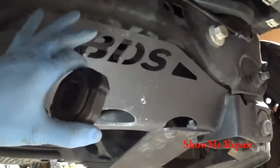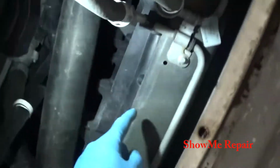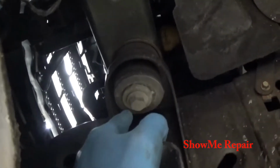And obviously I have a 6-inch lift on this thing. If you had a stock truck, you wouldn't have that opportunity anyway, because then that would hang down closer to the road, and you wouldn't want to do that. But what I did figure out is this radiator support here. Put this light up. If you look up here, this support is kind of the main support of the body that hooks the left and right fender. I think that piece even goes up. Yeah, it's where the body mounts to. You can see this body mount right there. That's that channel that runs along the front.